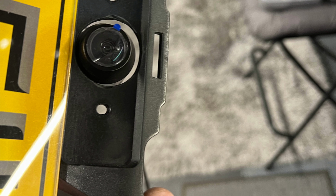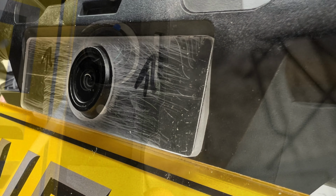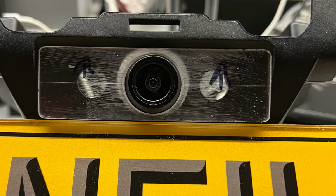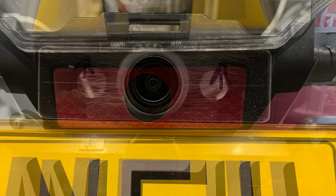So now we'll move on to the rear reflector. Rather than damaging and modifying the existing reflector, so the bike could be put back to standard at a later date if required, I used a piece of clear acrylic. This was taken from an old number plate, and I formed it to the same shape as the existing reflector. It will be adhered to the bike with double-sided VHB tape and finished off with a reflective surface, which is also a 3M product, and you'll see when it's done it looks quite effective, and I think this is quite a neat feature.